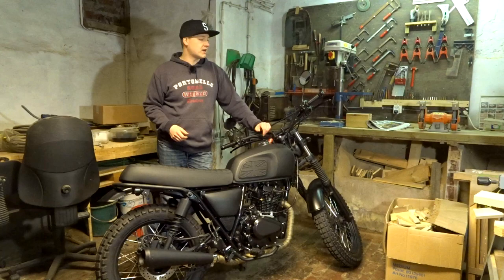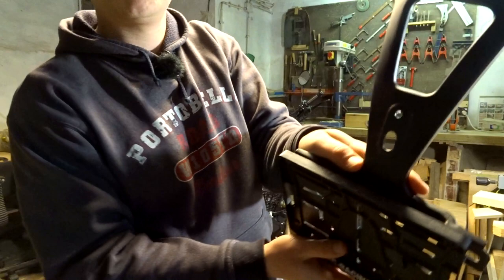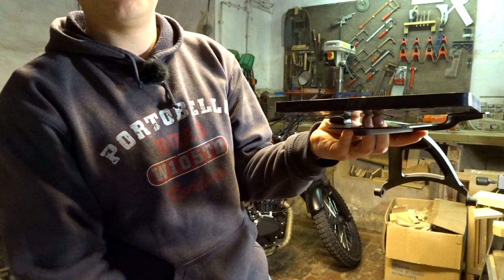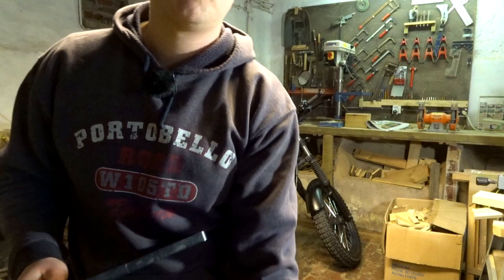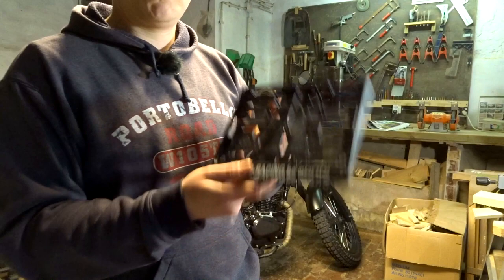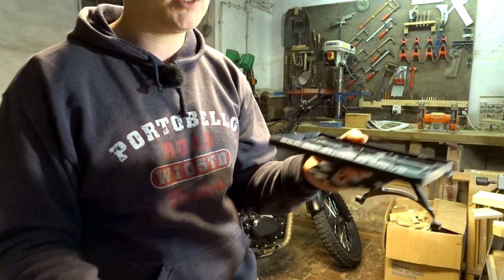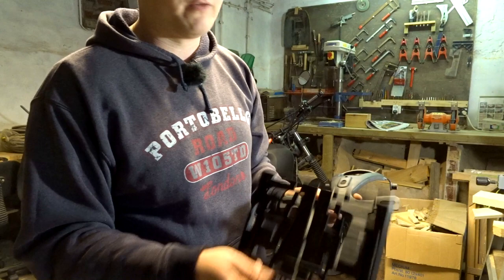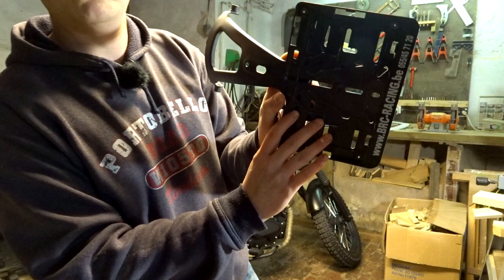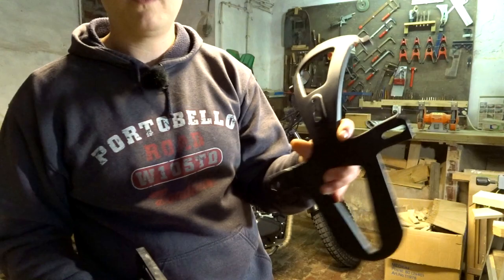It's cold — it's winter time. This is the bracket I'm talking about — we modified it before. When the license plate is installed with these two bolts, it can flex because there's no support on the back side, so the license plate flexes and breaks. I already got a replacement bracket from my local dealer. There was a rubber grommet on it but with the size of license plate holder I need, the grommet does nothing at all.